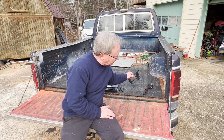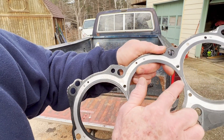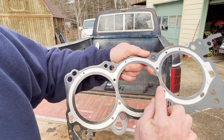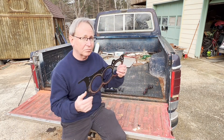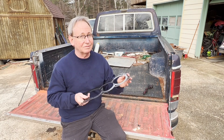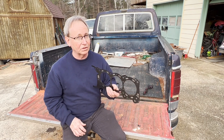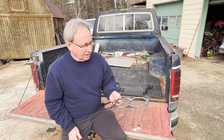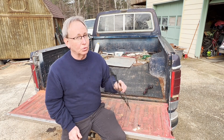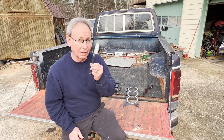Keep in mind — if you have head gasket problems, you can see the head moving around, and that was the leak between the cylinders. Honestly, you should never really have head gasket problems with cast iron blocks and cast iron heads unless you have incredible compression. So if you do have head gasket problems, as I said in the earlier video, you're going to have stripped head bolt thread problems — and you probably won't find that out until the last head bolt.